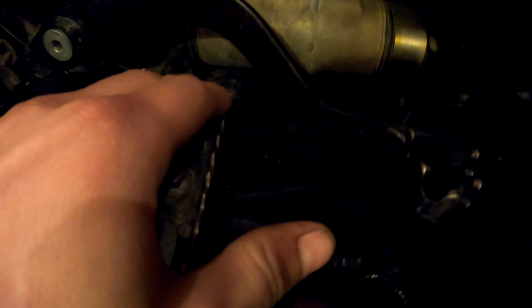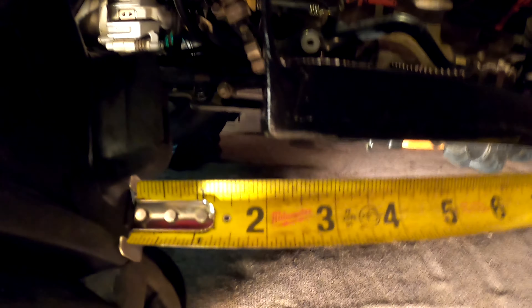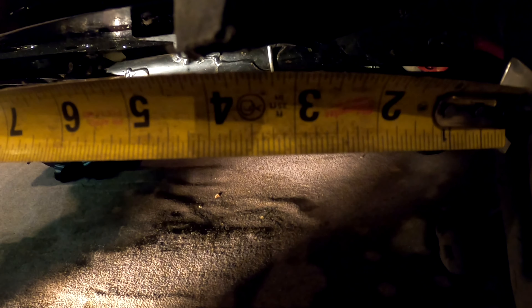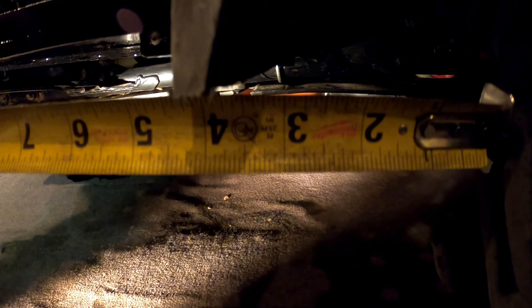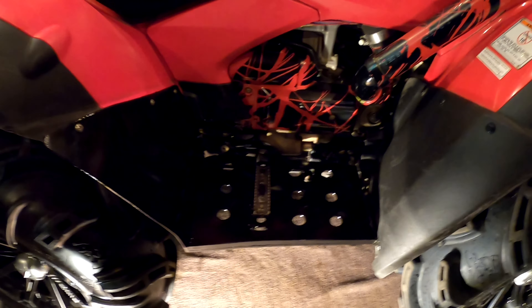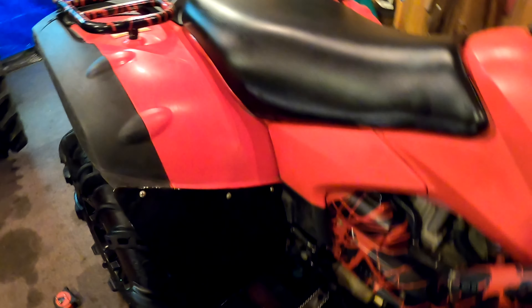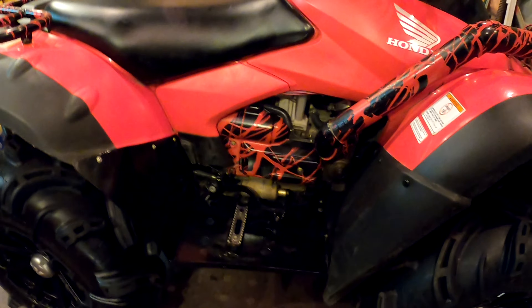You've got about two inches of clearance in the back, and about three and a half inches in the front. I don't have any rubbing with the 30-inch tires on here at all. So with this setup you can definitely run 30s. I'm happy with how it came out — it's got some nice curves to it. I tried to make everything as curvy as possible to match the lines I already have. If you want to clear 30s, this is a good starting point for building your own foot wells. Any questions, just leave a comment below.